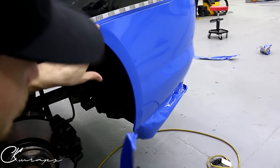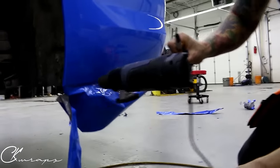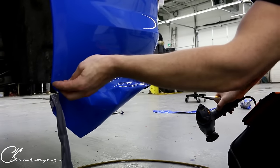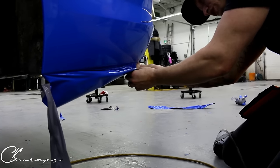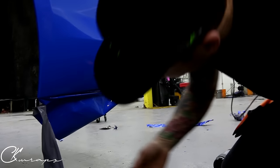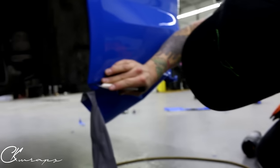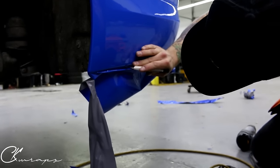Back of the blade — look at the back of the blade along the backside. Now that we get to the bottom, we'll finish off the top in a second. Let me trim off the bottom piece. I want to heat it, make sure it all shrinks — we don't need to go crazy amounts underneath, we just need to get it to the bottom edge because this bumper runs very flat underneath. If you can still see color from like 20 feet back, go in there and slap an inlay underneath, but you don't need to do all this in one piece — depending on the car it will vary.